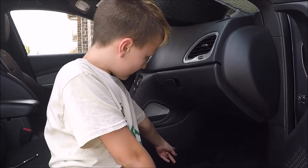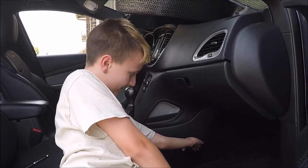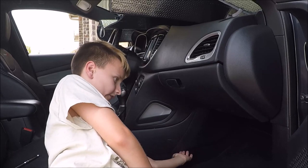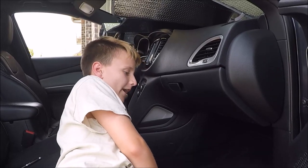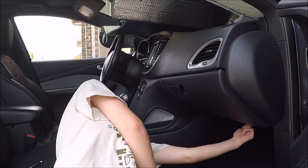The blower motor is hidden behind this panel right here. Put your fingers behind the panel and remove it gently, then you'll be able to get it out. After you're done with that, get the felt that's underneath the dashboard and remove that, and then you have access to the blower motor.